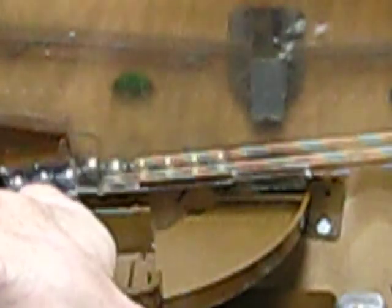These balls here came through the front of the machine, and now they should each be a payout. Every time one of these balls goes through this payout mechanism right here — which sorts out one ball at a time — it triggers a bunch of mechanisms to pay out. I think it's seven balls per win for each ball, so each ball will represent a payout of seven balls. They're just waiting there for the machine to be unlocked, and that's going to happen by filling up the hopper, and then the whole sequence should continuously pay out on its own until they're all done.